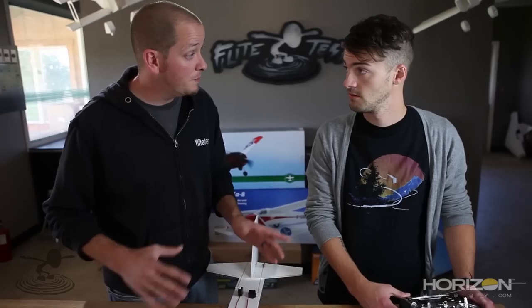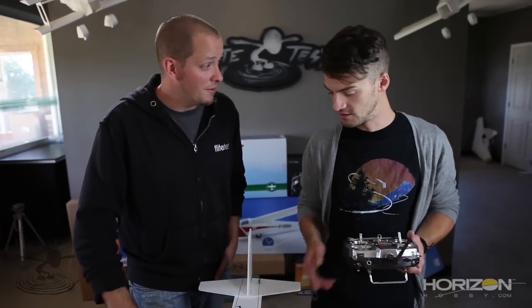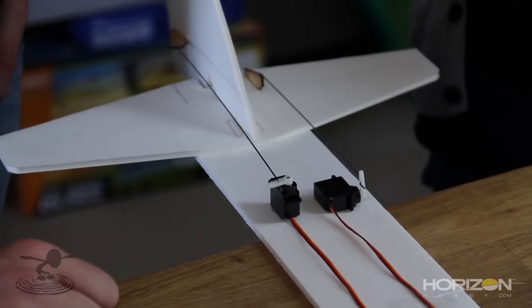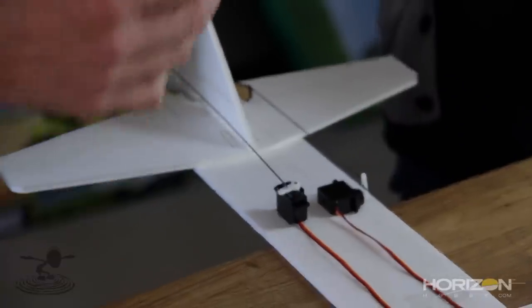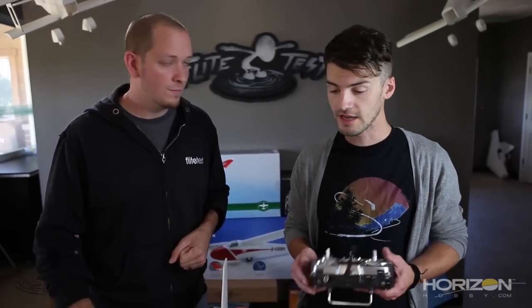This is basically the whole setup of your airplane: your battery goes to your ESC, which has an internal battery eliminator circuit, then into your receiver providing power for the servos and receiver, and all your controls branch out to the different servos. Speaking of servos — they're like the muscles of your plane. They're little units with arms that tell your plane its different functions. Nine-gram servos are by far the most common for beginner trainer-style airplanes. Inside, it's simply a gear-reduced motor with a potentiometer that tells it exactly where to go.